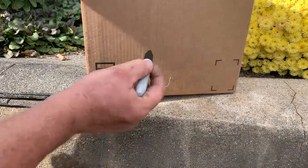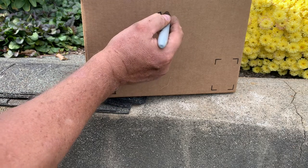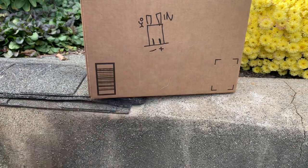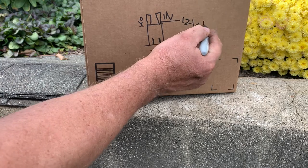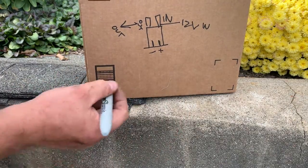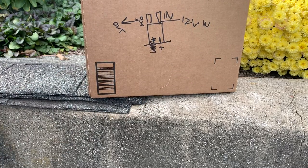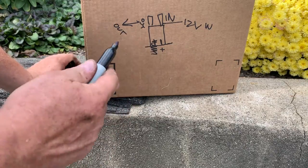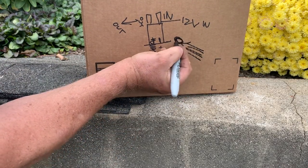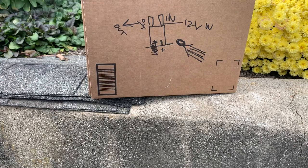So basically, in a four-post you have the solenoid with your in and your out. You have your two small posts — it doesn't matter which one is positive or negative. You've got your 12-volt in and your out, but you need to put positive on one and negative on the other. With only a three-post solenoid, I don't have a negative post — my whole frame is the negative. So you don't want to screw this to the frame because then it'll constantly be on and defeat the purpose. All these wires come in, terminating to an eyelet terminal, and you need to get ground to it only when all the safety switches are satisfied.